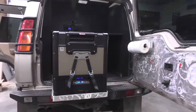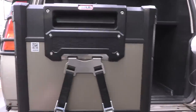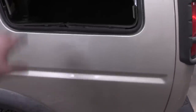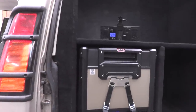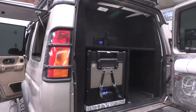I've got my budget fridge slide all hooked up and it seems to be working fine. I have the fridge plugged in and I used this ARB tie-down setup - it was super simple and everything seems to be working really well together. We've got a fridge that slides, and it is plugged into my battery bank which fits perfectly in the void that used to be a seat. The battery bank is going to be plugged into the rover, and every time I start the rover it will top the battery bank back up. The battery bank is extremely deep cycle so it will keep this fridge running for days in between charging. This is a very nice little system that I've had in my mind for a while and I'm getting really excited.